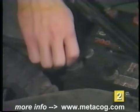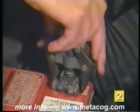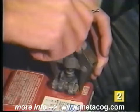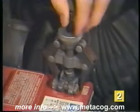The battery terminal connections should be periodically cleaned and inspected also. For proper cleaning, the cable should be removed from the battery. Always remove the negative cable end first. To safely and easily remove top post battery terminals, we recommend using a battery terminal puller. This will assure the battery or the battery cable ends will not be damaged during removal.